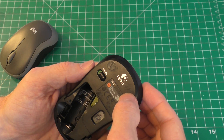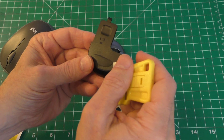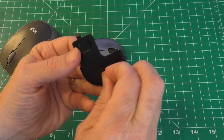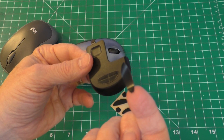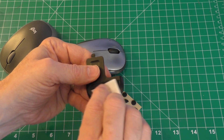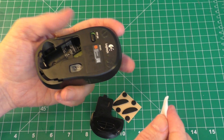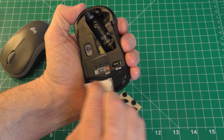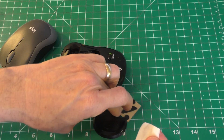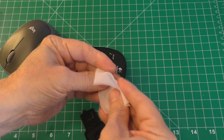The top pads are pretty much gone, so we can just wipe those down. But the bottom one really needs to come off. I'm going to take a little tiny blade and see if I can peel that up — and sure enough, it's coming off pretty easily. So it's off, and I just have to wipe it clean. Taking one of these wipes that came with the kit, I'm going to clean all the glue residue off and let that dry, then do the same up top. I'm not going to touch these surfaces after cleaning so I don't get fingerprints on them, and I'll wipe my fingers too.